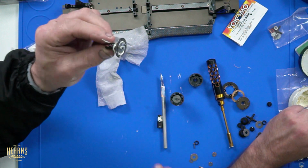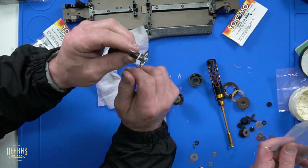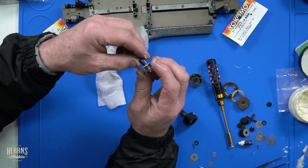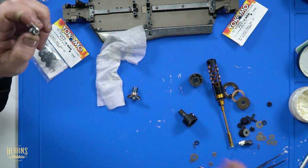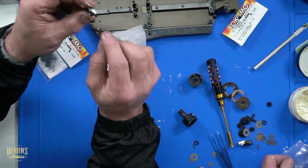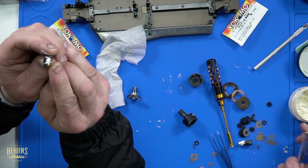So I've just put the fine shim on the outdrive first. Damn fine. Brett didn't even consider saying anything about it. But you got the outdrive, and you got lube on, which is like too much because it'll squirt everywhere. And then you get a shim that goes on here, so the actual outdrive is not rubbing directly on the plastic of the case. There's a shim.